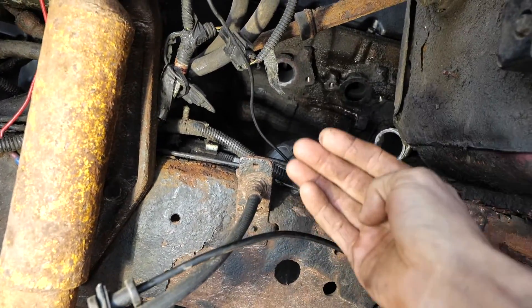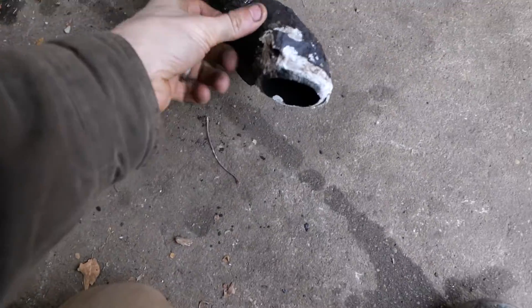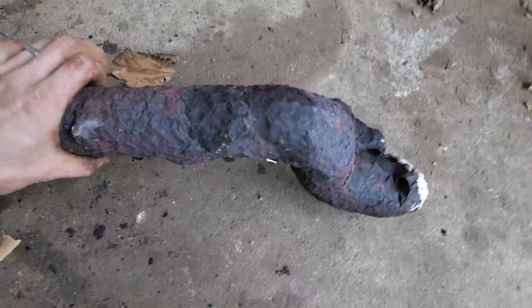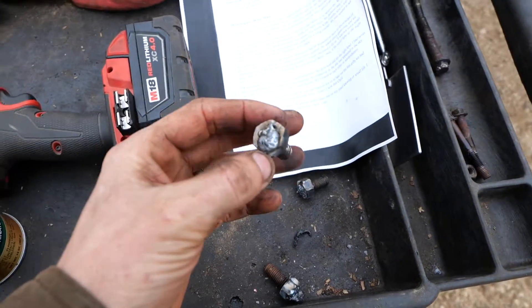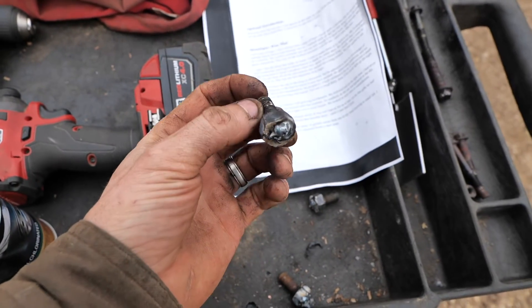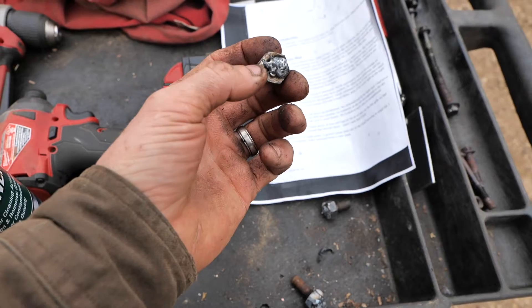Once I ended up having to cut these, I took the oil cooler off so I could cut — because when you're cutting the bolts you're cutting from underneath on the manifold. Obviously the manifold had to be unbolted from the up pipe. The manifold mounts like this, so you have to cut from underneath to get those bolts. I cut from underneath and cut all those bolts off. Then — this is a common method — you put a nut over the stud and weld it. You need a wire feed welder, though I've done it with a stick welder too.